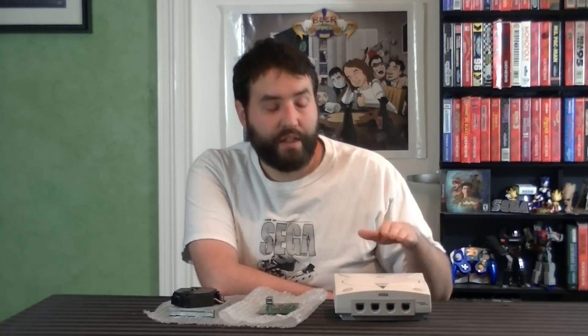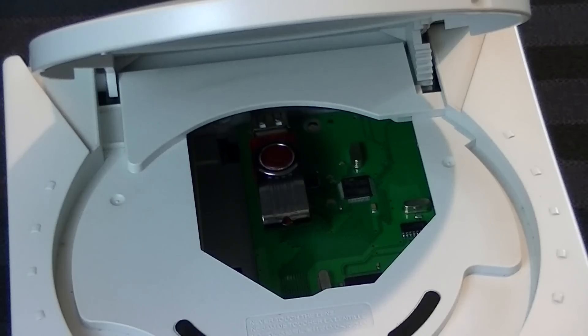Now, if you know the Dreamcast, you know there is no USB port on the back of it — there's no space for one. So what you would actually have to do is cut the plastic to make space to be able to use this thing. When I first saw that, I didn't like that — I thought that was a bad idea and that's what actually kept me away from it. But this version of the device, the guy who makes these things actually flipped the USB ports so they're facing inward. What that means is that you don't have to cut a hole in the back of the console anymore.